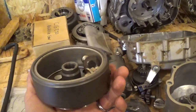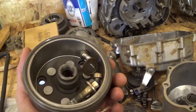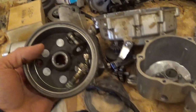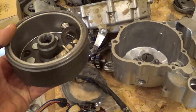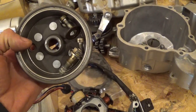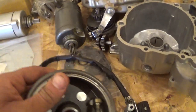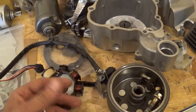Another thing I've asked around about is whether it needs a different flywheel. I think this one has eight magnets going with eight coils. The new one has 12 coils. One guy says it won't work — that you need an equal number of magnets or it'll zero itself out. The other guy says it'll work just fine, that you could have one magnet in there and it would still work. So I honestly don't know.